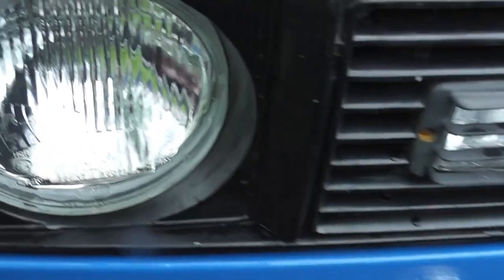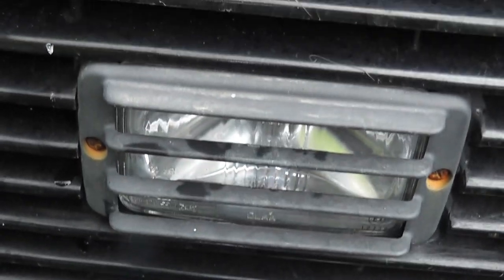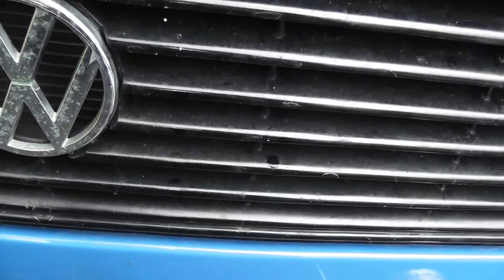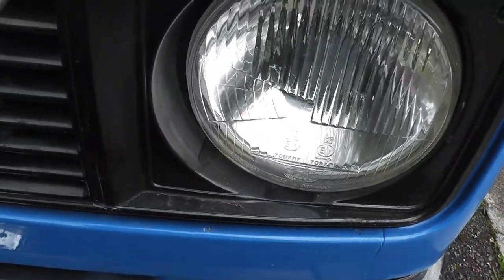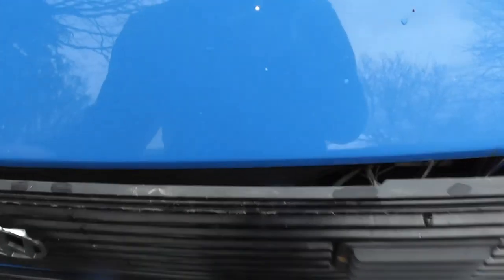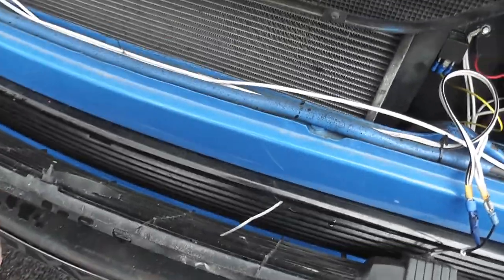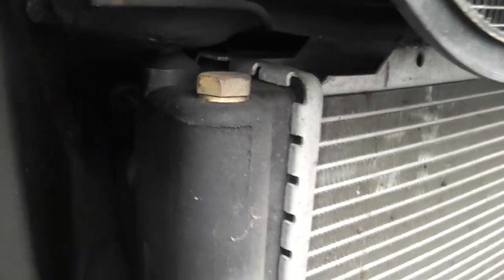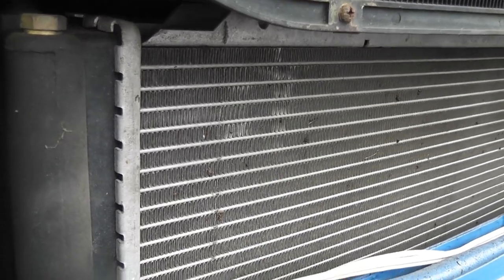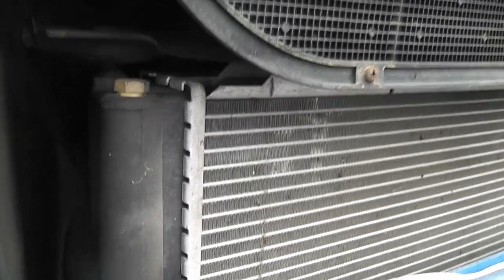What I'm doing now is removing the front grille of the van. Each of these five screws you just turn 90 degrees, and then the grille just lifts off. I have spotlights in the grille so not everybody will have them, but that still gives plenty of room. That lad there on the top of the radiator is our bleed valve. We're going to be opening that, but not just yet — leave it closed for the moment and we'll get the pressure put on first.